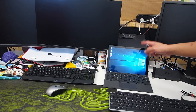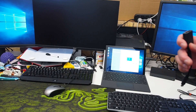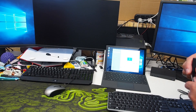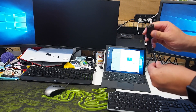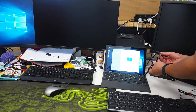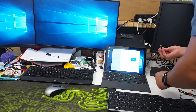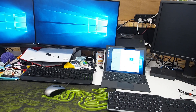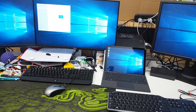So here I have the Microsoft Surface Pro 6. Now I've also got the Dell D6000, which is a universal dock itself, to try and get all three external monitors working on this surface. And I think it is a limitation of the Dell dock not able to drive three monitors. I've got here a converter for mini DisplayPort to normal size DisplayPort. So let's unplug one of the DisplayPorts on DisplayPort one and plug it directly into this adapter. So now we've got one, two, three for display. And we'll just plug this one directly into the surface. And yes it does — it will run three external screens in this configuration.